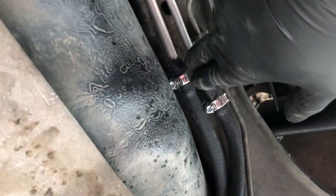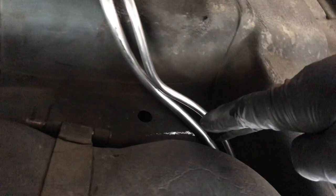So what I did is got the hose lines and I put them right here, and I ran them from there and over to that side, and I just zip tied it right here. Kind of bent this a little bit so it doesn't nick my fuel line there, and I made my own hard lines right here. The feed and return, the clamp too, through there, which is, there's enough space right there, just like stock, all the way up there.